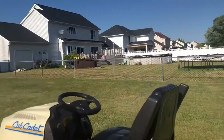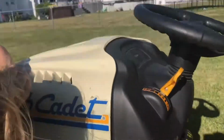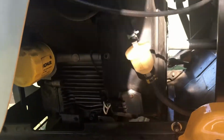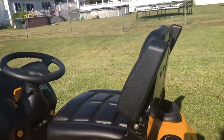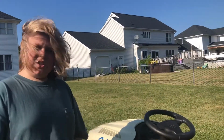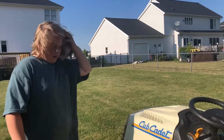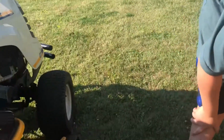The way that the 2500 series works is, since they are a little bit more rugged machines, they have a fully solid stainless steel drive shaft that goes from the flywheel of the engine all the way back to the cast iron transmission. In case you have a 2000 series machine, it's aluminum. The 2500 series is preferred because you actually get a bigger model BDU-10 transmission, and you also get the cast iron case, which is stronger. These do have greasable wheels. I don't think those are greasable.